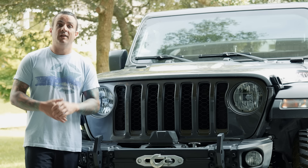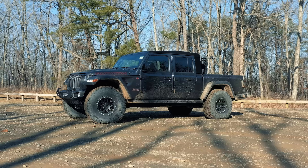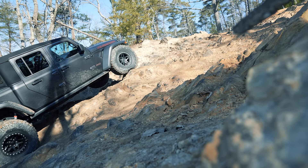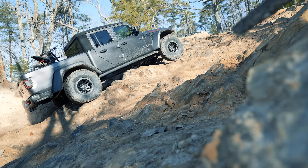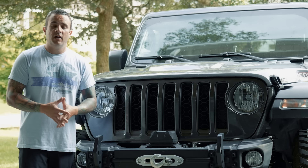Let's go over a few quick basics. I have tested a one-inch lift and one-inch spacer on this platform previously. What I can tell you is if you want to run a 37-inch tall tire, you don't really need a tall suspension lift. That being said, if you plan on taking this thing off-road it will greatly benefit from one. The challenge with the Gladiator platform is that it is very long, so on even the easiest trail if you're doing a lot of uphill climbing, it's very common to hit the frame rail of the Jeep. So I needed to get this thing a little bit higher before I took off on my trip to Easter Jeep Safari earlier this year.